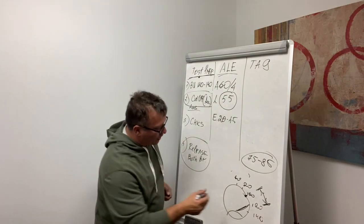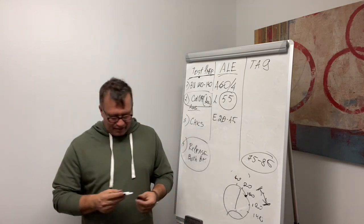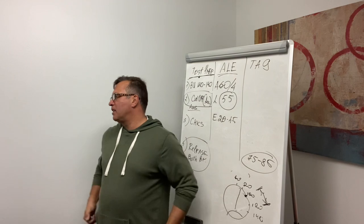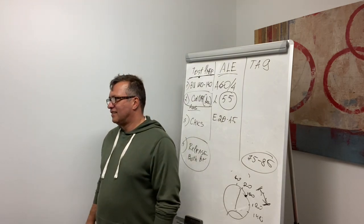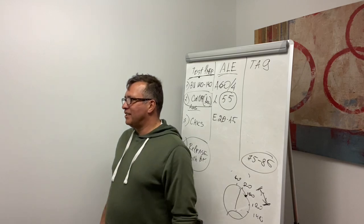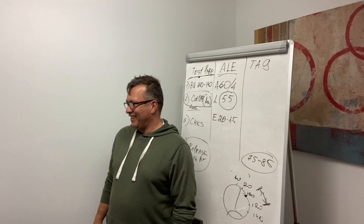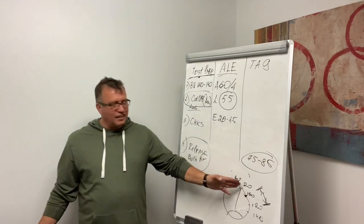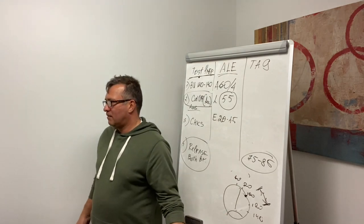And even though your arrow is here now, you're declaring to the examiner, "Yes, so my system didn't lose more than 4 PSI during 60 seconds, which indicates that my system is working properly." And the examiner goes, wait a minute. 120, 140, and 80. No, it didn't drop 4, it dropped 40 or 45.